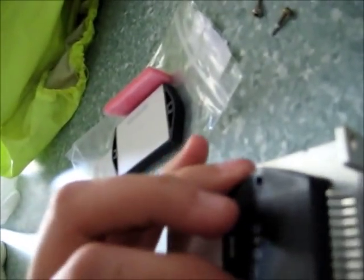Once you've done that, put a little heat sink compound around the back. Then you put a new one on and just centre it around a bit to spread it. Then you screw it down and it should ooze out a little bit evenly all around it — and that's how you know you've got enough of the heat sink paste. I'm grounded here — there's a foot in the concrete, it's still a little bit moist, so no static. I've got plenty of compound on there — it's oozing out all around, so that's good.